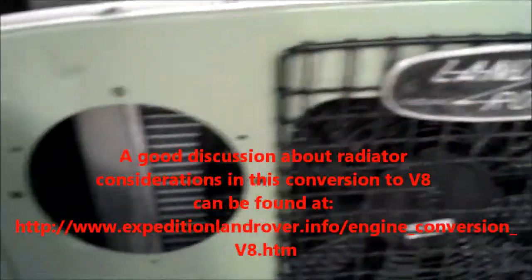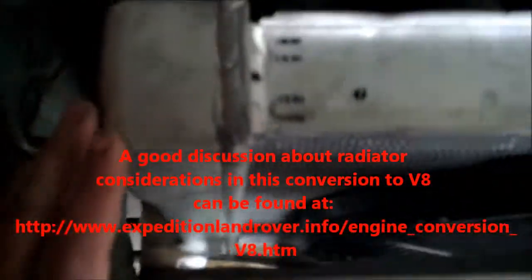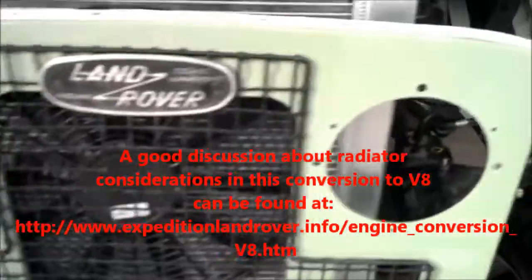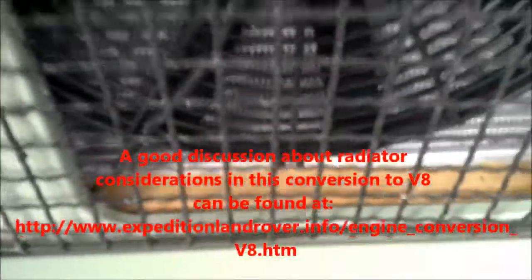The reason we did the pusher fan is because it allowed me to have a little more room coming forward into the space before the grille. It also allowed me to push the radiator back a bit in order to have room for the headlights. So that's really kind of how we're going to have to go. Right now it's sitting on a 1x6, just roughly in place.